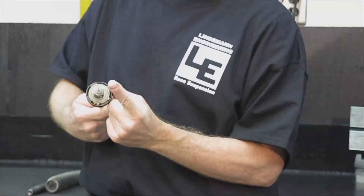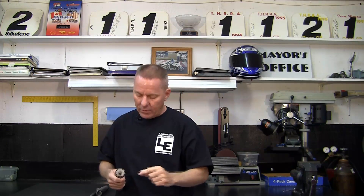We got tired of those limitations and invented a cartridge system, which is what's in a shock and in modern forks. The difference between a shock and a fork is the length: in a shock you have to fit everything into a small space, hence one piston with a shim stack on the top and the bottom. In a fork you have more space and can have a piston for rebound and a separate one for compression. What we've done is replace the hole in the damper rod with a piston that has a port. Because we have a stack of flexible shims on top, we can control the effective hole size — the shims bend open more or less depending on their stiffness, so the stack opens a little when oil moves slowly and progressively more as force increases.